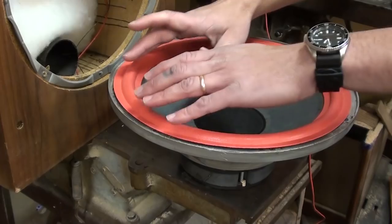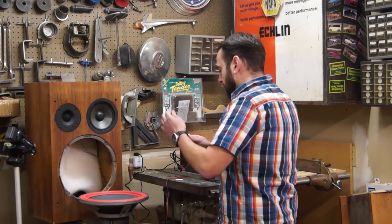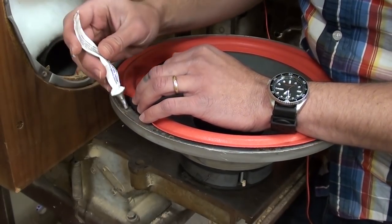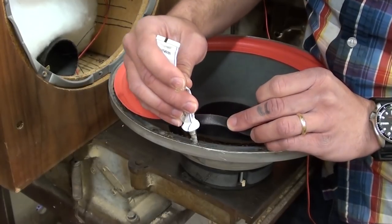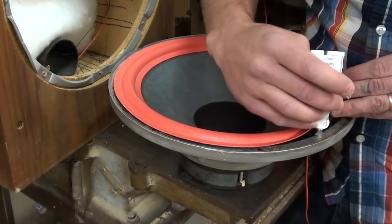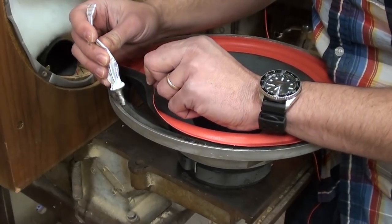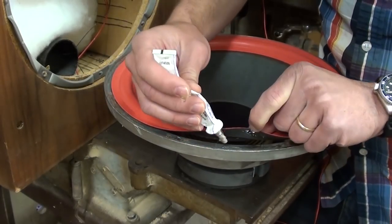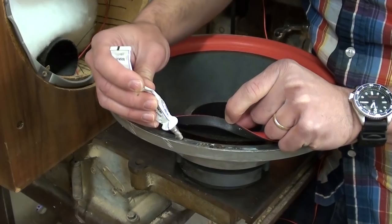Make sure it's not buzzing and it's right in the center, then press down around the outer edges. The glue is the same as before — apply about a one-eighth inch bead all the way around the outside edge. This glue is sticky stuff, so be careful not to get it on the speaker foam surround or on the screw holes. Don't use too much glue because it will push out and get stuck where you don't want it.